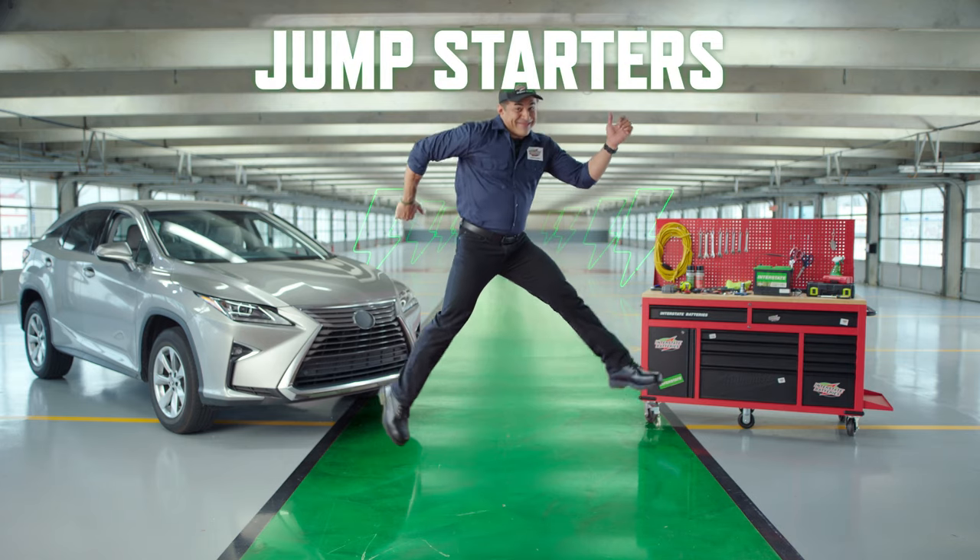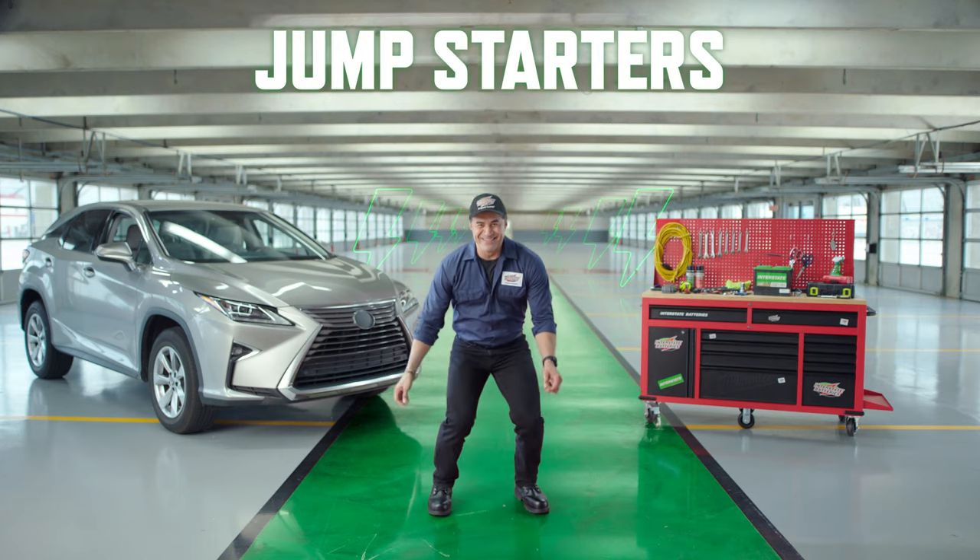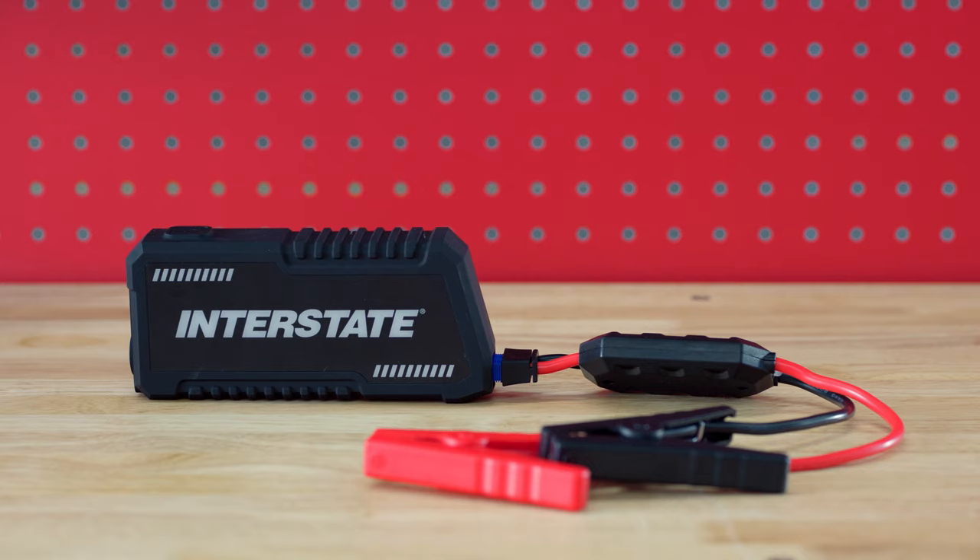Last among the chargers is not a charger at all. A jump starter is what you use for a jump. Let's take a moment and talk about the difference between jump starters and chargers. A jump starter is solely for a quick jump — it will not charge your battery. The purpose of a jump is to get you enough charge to drive directly to the nearest auto shop. A charger, like a trickle or solar charger, is what we recommend for maintaining your battery. A heavy-duty charger — fully automatic, either 15, 20, or 30 amp — is what we recommend to charge your battery fully.